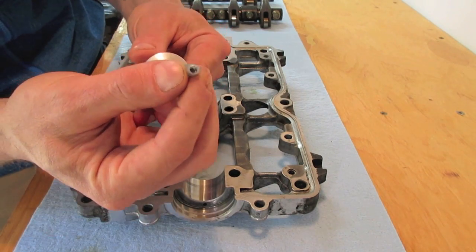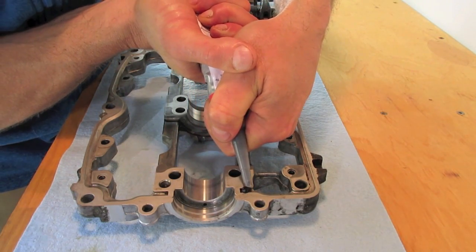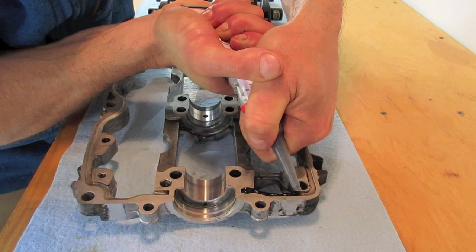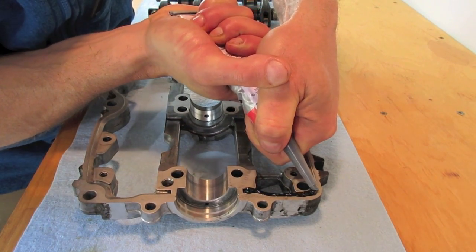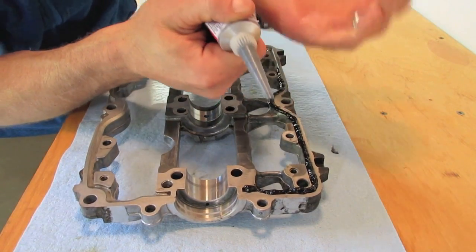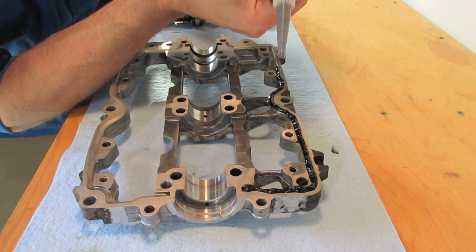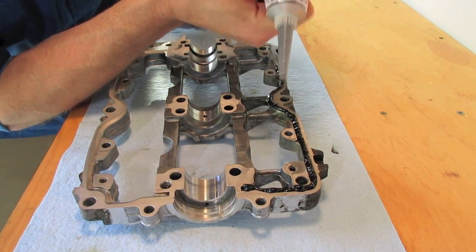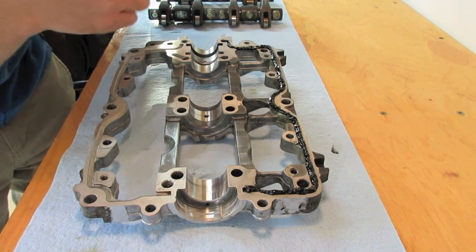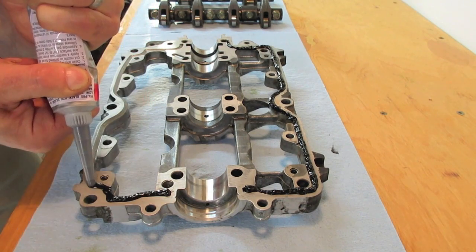It helps to have a cone-shaped tip — cut it off so you have control of the size of that bead. Just work it around getting a nice even bead in that little channel. Take your time and be patient. I use two hands: my rear hand squeezes from the back and my front hand guides it, resting my forearms on the table. Squeeze with the rear hand — mostly with the thumb — and guide with the front hand. Work it around both sides slowly.